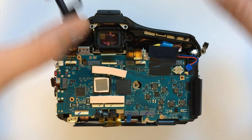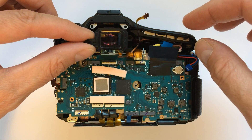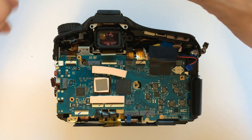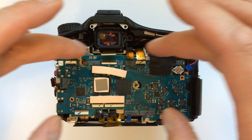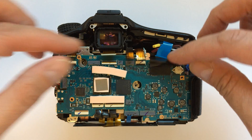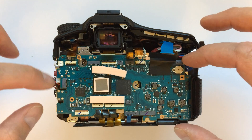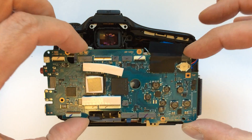There's also this little eyepiece diopter that has to come off — it goes on there — and one little ribbon cable on that. Then the circuit board has about a dozen ribbon cables all the way around, and also other power and trigger connections. Lots and lots of cables on both sides of the board that have to get pulled off to remove the main board.